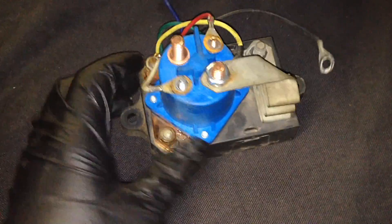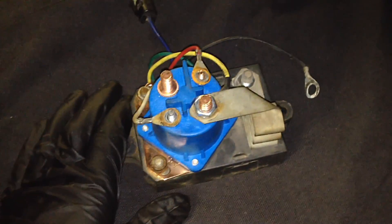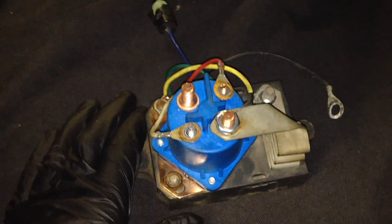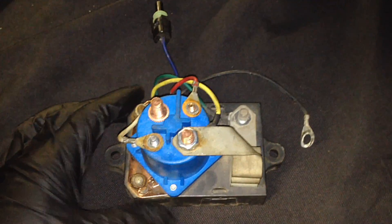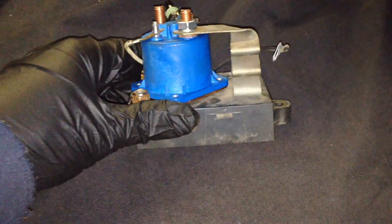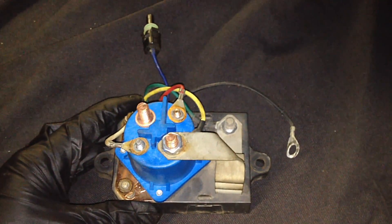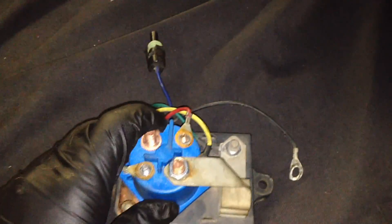So it is a weird system. From what I've read, the solid-state part really doesn't go bad — they don't burn out; it's all low-current stuff. Whereas this is still a high-current relay that can burn out over time from the initial current draw and contact wear. I just wanted to go over it, explain how it works, so you'd have an idea — it looks like something out of Frankenstein. That way you know how to test it and whether this relay is good or not, and then you can move on to testing your glow plugs and the glow plug harness themselves.